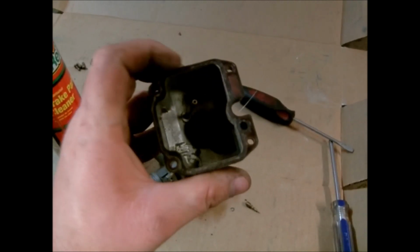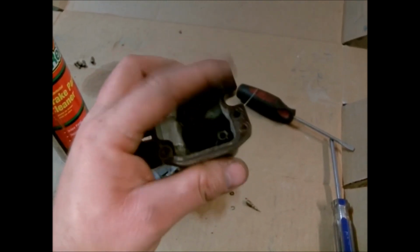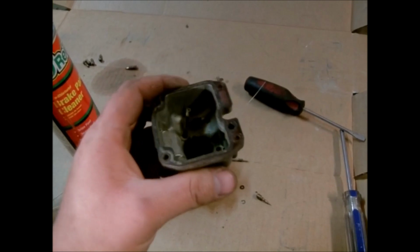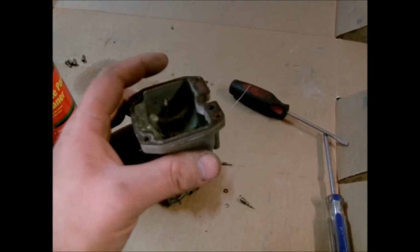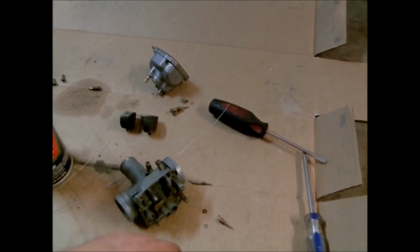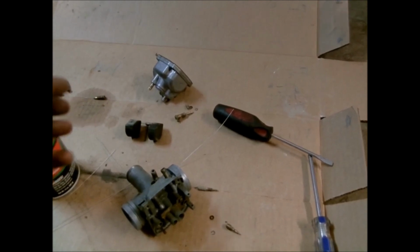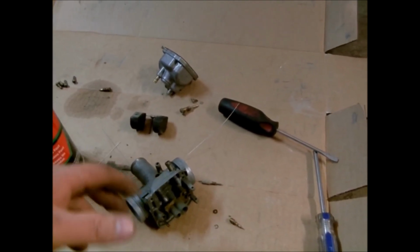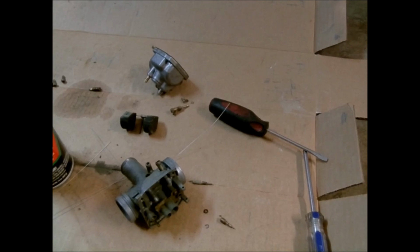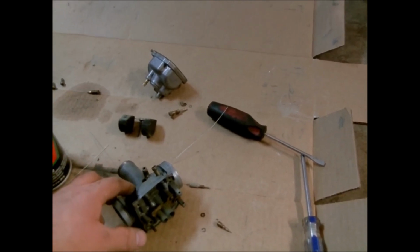And of course, it's really hard to seal gasoline. Anything silicone based will just dissolve as soon as the gasoline hits it. So Permatex, silicone, all that stuff you can't use. I do have some kind of a gray sealer that I use whenever I rebuild two-stroke engines, like say chainsaws, dirt bikes, whatever. And where the cases meet whenever I split the case on one, I will use that gray sealer to seal the cases back up. I think they say it's gasoline resistant, so it of course can't be submerged in gas and still work.